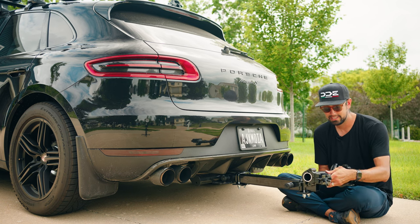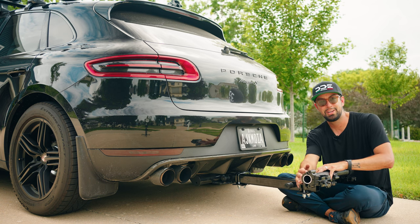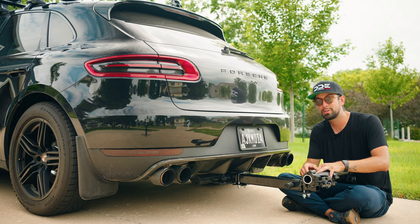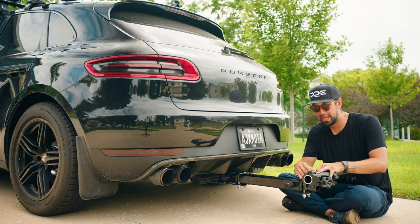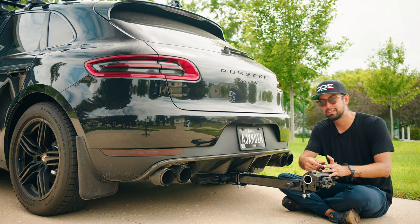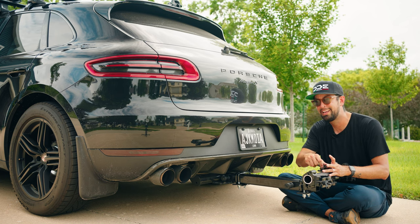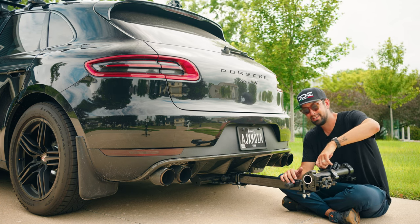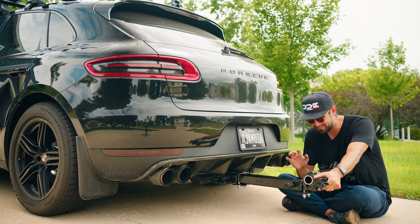And similarly to what I said about your connections being 90 degrees, I know that since this is perfectly horizontal and this is going to go perfectly vertical, I'm going to want this joint to be locked. And so I went ahead and put pins in, and pretty much every joint on this vehicle is locked, unless it cannot be locked because it's coming off of the two first rails that we put on at an angle that's not 90 degrees. So when in doubt, and when you can, put a pin in so that these don't rotate. That will keep your rig much, much safer.